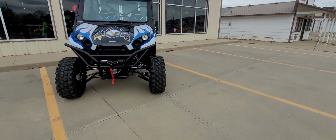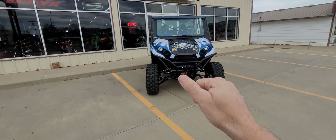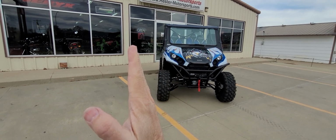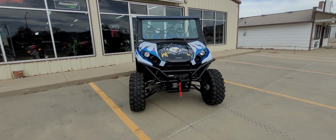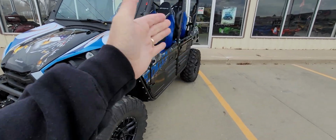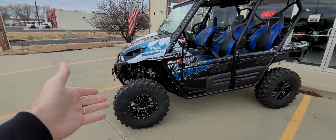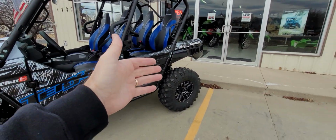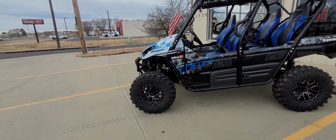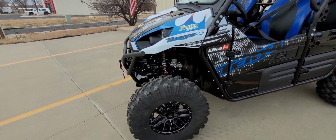Negative camber is good. The purpose of negative camber is that as you turn that way, the chassis rolls this way, and the tire goes from a tilt to straight to give maximum bite on the outside tire. So this is our most common setup. If I have somebody that's going to drive a little bit more aggressive, I'll probably go 1.5 to 2 degrees on the front and probably 1 degree on the rear, and that'll allow for better high speed cornering capability and all that good stuff.